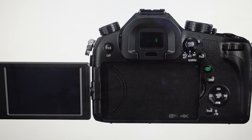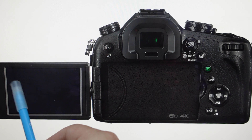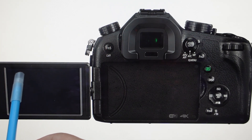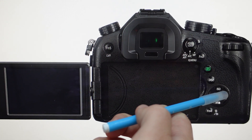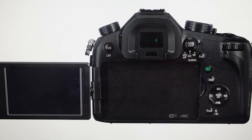All we need to do is with the camera on, we're going to hit the menu set button to open the menu on the screen. Once the menu is up, you'll just go to the setup wrench icon submenu, and then from there you'll select reset. Menu, setup wrench icon submenu, reset option, and then you'll be able to reset everything back to the way it was when it came out of the box.